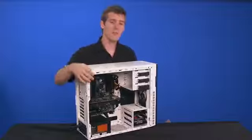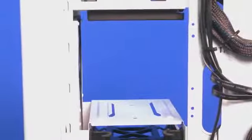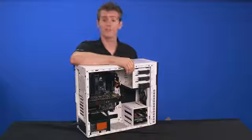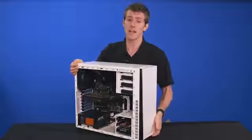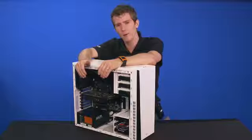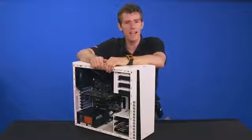At the front, one of the drive cages has been removed from this configuration for a very good reason — it enables much freer airflow from the front of the case directly onto the graphics card. In a configuration where you're liquid-cooling the CPU, the GPU is the most important component to get fresh air delivered to. And that 750-watt power supply will easily support a couple of graphics cards in CrossFireX.